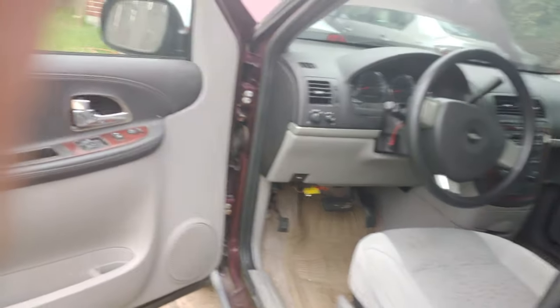And I tested, meaning I checked which connection is which. So I think the airbag is right over there. The airbag is over there, because I disconnected this. This is the power. This is the seat belt. Airbag is right over there. And the airbag light is still on. So my last resort, I think it's the airbag sensors.